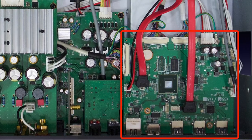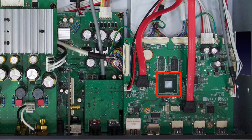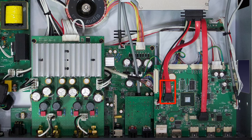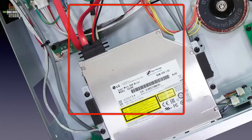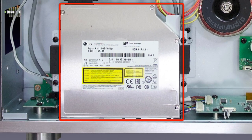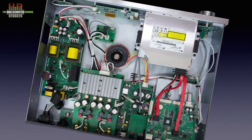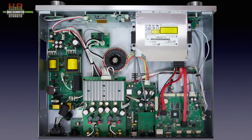Completely on the right, the processor board holds a dual-core ARM Cortex-A9 running at 1 GHz with 1 GB main memory and 8 GB storage on eMMC — the more economical sibling of SSD. A SATA port is connected to the hard disk slot beneath the processor board, and a second SATA port is connected to the DVD-R slot drive mounted towards the front, a readily available LG drive. Other parts mounted on the front include two PCBs holding the rotary encoders and the board holding the driver electronics for the screen. It all shows the modular thinking of Cocktail Audio — all modules use about the same computer code and, where appropriate, identical PCBs, like car manufacturers use platforms to design a wider spectrum of models at lower cost.